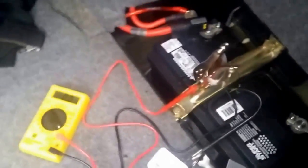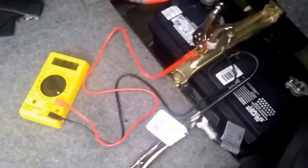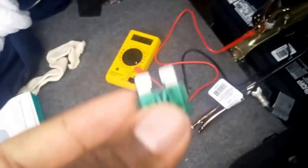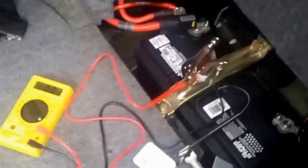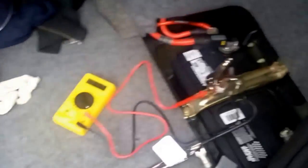So this is Ant E46 Source showing y'all how to diagnose if your car has a parasitic draw. This is how you do it: hook your multimeter up to your battery and go through there and start pulling fuses until you find the culprit. Now this doesn't fix the problem, just to let y'all know, but it helps diagnose the problem. Now that I have this fuse pulled, my battery is no longer gonna get drained overnight — the car can sit and it'll crank up fine every time. I don't need the fuse anyway because my radio isn't working or playing any sound, so it's not like I'm losing anything by pulling it.